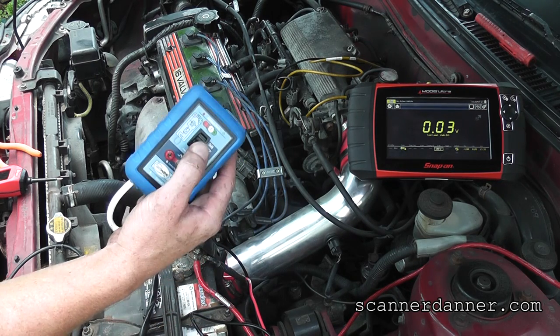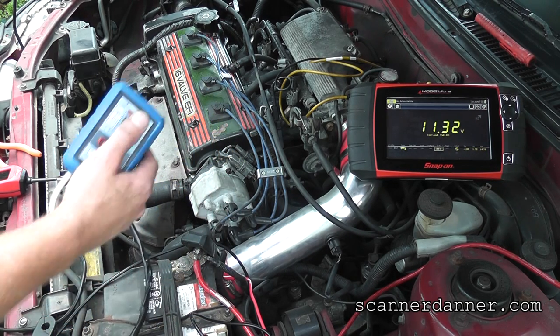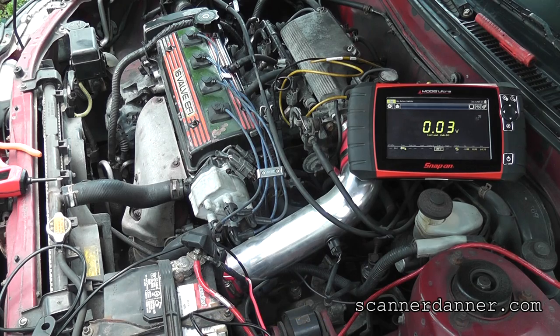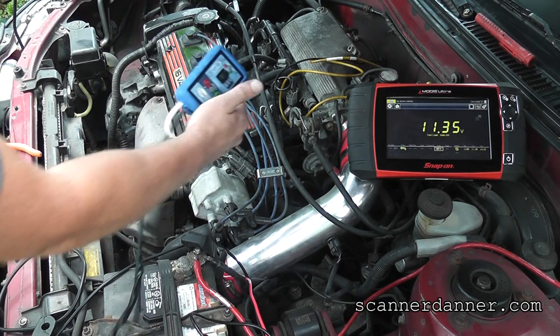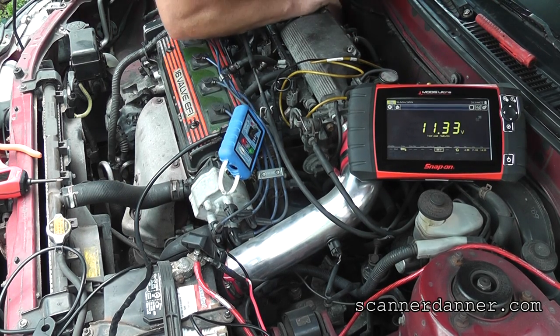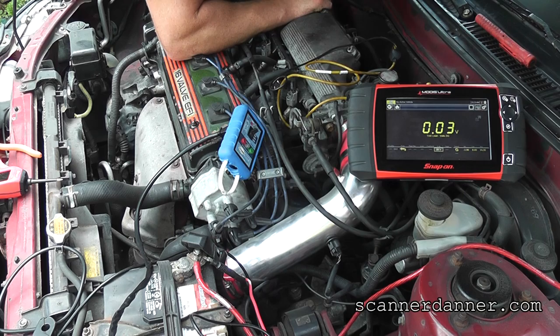And just so you guys can see, flip the switch. That's the control side. I showed you the load side loaded. This is the control side loaded. Last check is going to be the starter ground itself. So I'll leave this switch in the on position. And then the last check is really for me to just take this meter and touch it on the starter housing. It would be awesome if we had a bad ground. I would absolutely love it for my sake.